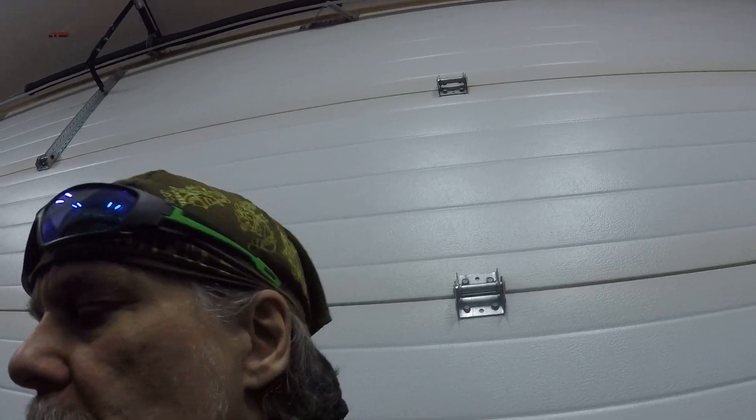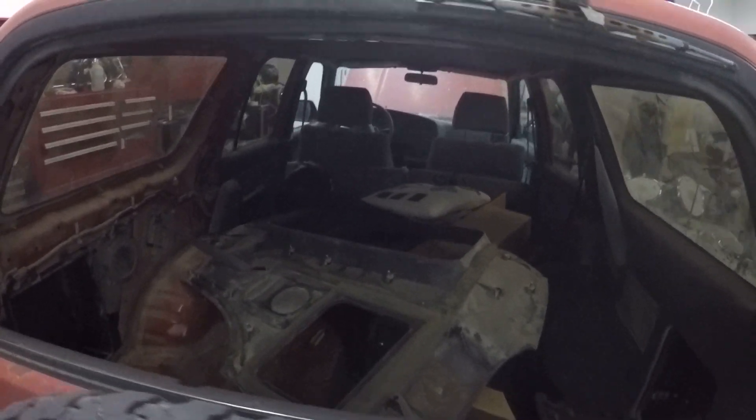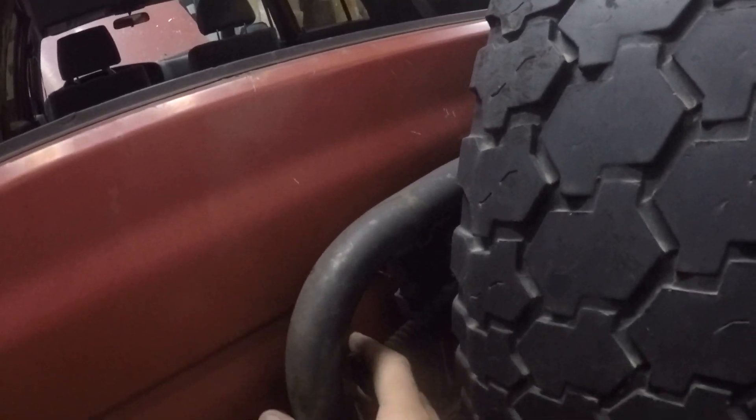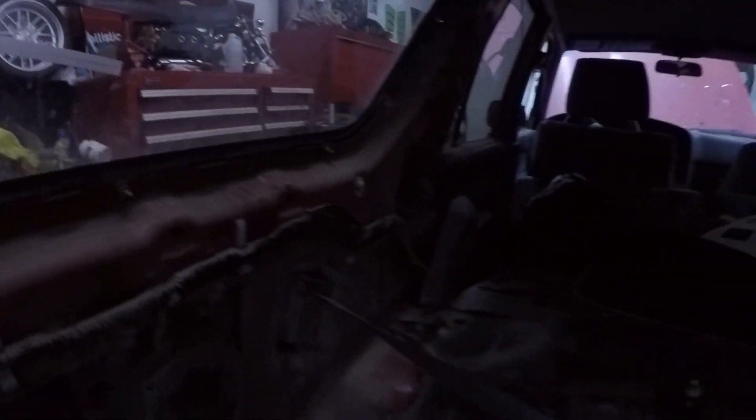The body work on this side is the worst, and I needed to know whether any of this is actually going up into the cabin. I wasn't sure. So I decided to have a look on the inside. I started to put the key in here and turn it — that window rolls down. You've got a little tab here you pull that swings this out, then you unlock it and a lever here opens it up. I pulled this panel off to have a look, and when I looked down in there I could see light through there. So that does come into the interior of the vehicle. In order to make it safe, I've got to patch all those holes and make sure no exhaust can come through. That's what I'm working on right now.